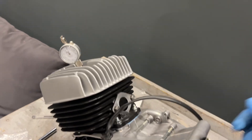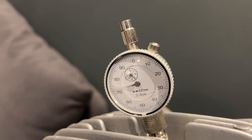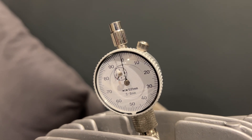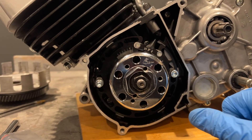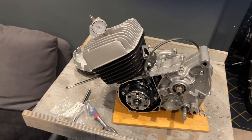I'm going to time this two millimeters in advance, so all I'm going to do is wind it back — that's one millimeter, two millimeters — and there you go. Then all I'll do is mark the two lines up on the flywheel to the ignition, and that's it for this HPI kit.